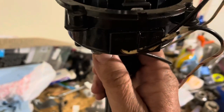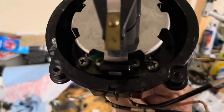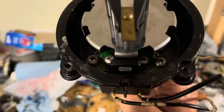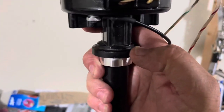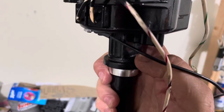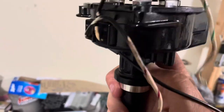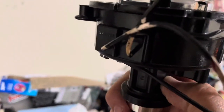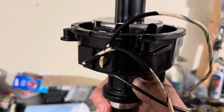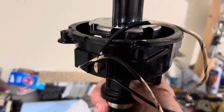So if you have, say, a 1996 to 2005 Chevrolet truck with the 4.3 or the 5.7 V8 engine, you'll notice your distributor is not adjustable. The body is actually square and the clamp holds onto that square part, then locks down on the intake manifold — you cannot adjust it, you can't rotate the distributor. It holds it in one place only. The reason is because the trigger is actually off the crank; there's a crankshaft trigger that signals the computer, so this distributor no longer has a trigger for the computer to fire the ignition system. So they locked down the distributor to prevent adjustments.